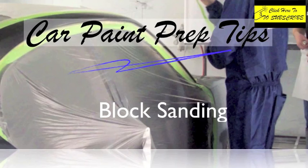Now the best way to do this is to use what you call a guide coat. And this comes in dry form, like a powder you put on there on the primer area, or they also have spray that you spray on there. And you want it to be a contrasting color. For example, if it's a gray primer, you can use a black guide coat. And what that does is just helps you identify any highs or lows.